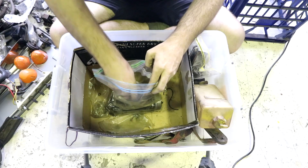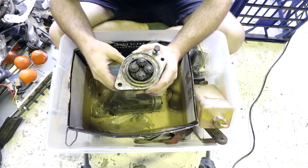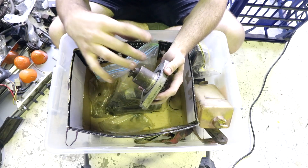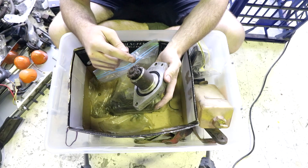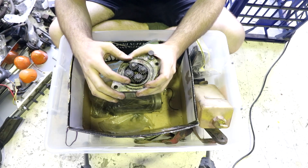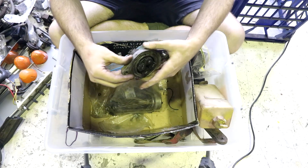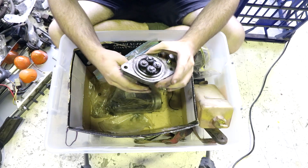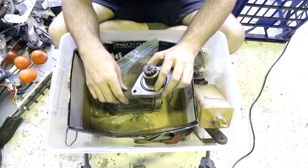There's this big bag that I've been delaying opening. So remember how I was talking about when we looked at the starter motor in the last video — it had that planetary gear in it. So this is the front half of the planetary gear setup for the starter motor. You can see this is the sprocket that that chain drives on. So this is actually in the timing case sealed part of the engine. Rather than starting off the flywheel like a toothed flywheel like every other car, it actually starts through a chain onto the front of the crank. It drives through this star-like planetary setup to get the reduction. The flywheel on this car is like this big so it wouldn't work, so they're using a planetary reduction to get the starter leverage. This will be a nice part to clean up. Starter planetary set.